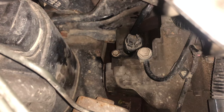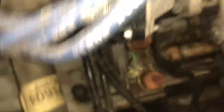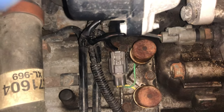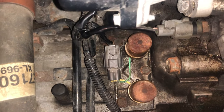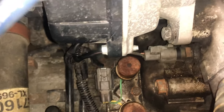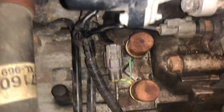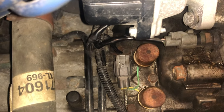These solenoids have three 10-millimeter bolts — you can pop those right off. Check that wiring harness and make sure there's nothing in there; you can clean those up. There are two little screens inside. If it looks really clean, you can usually put the gasket right back on and reuse it. You might have to put some black RTV on it if the gasket looks bad.